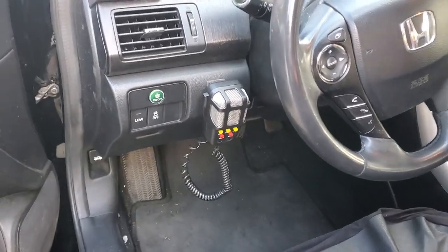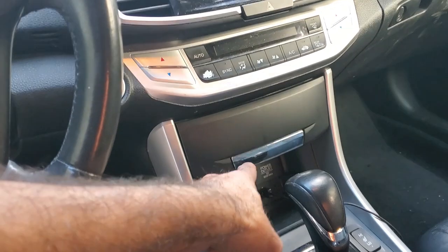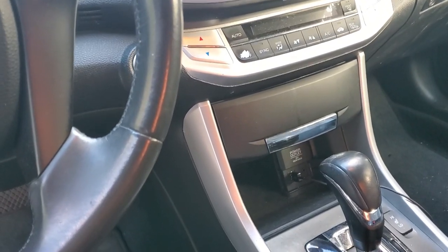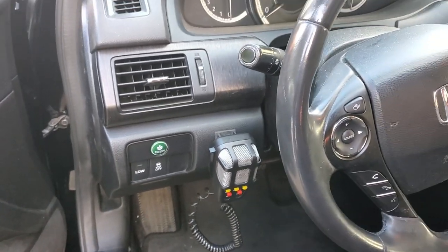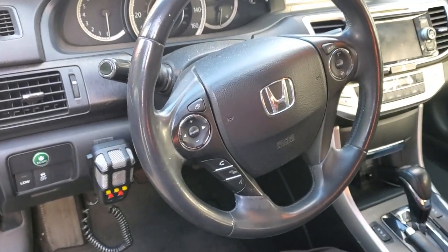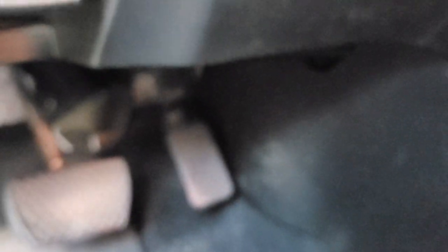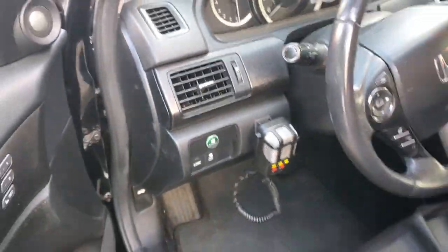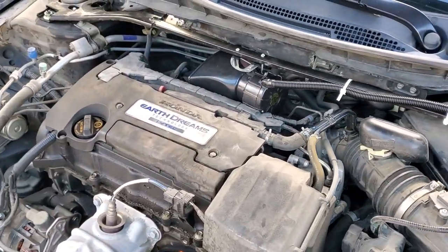So that's what the final product looks like. All the wires are nice and neat and tucked away. Power is being drawn from this cigarette lighter outlet here, and that itself has a fuse, so I didn't feel it was necessary to add a separate fuse to the power line for the speaker. It's essentially the same as plugging it into the power outlet, just a little bit neater. You can't really see any of the wires — they're tucked away behind this panel, carefully routed underneath. That's the power wire there. Come out to the front — all nice and zip tied up and it looks okay.